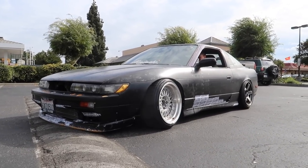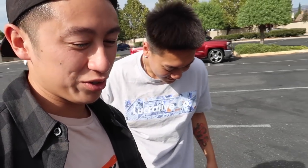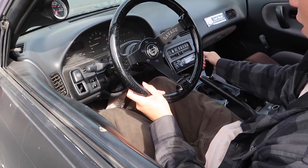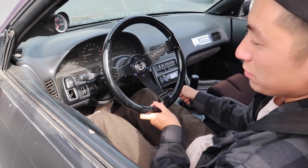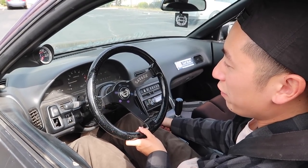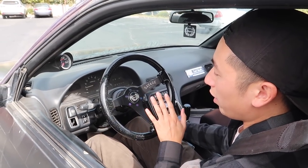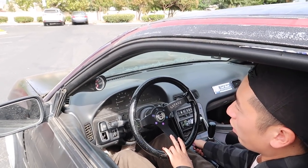It's fine bro, don't worry. Still trying to get Jason used to the clutch. So I'm gonna give Jason a little demonstration on how you basically get over the speed bump and control the clutch. So here's how it works: I'm in first right now. As I'm slowly moving my foot and the car starts to want to go forward, I hold the clutch there. Once it starts grabbing, you literally hold the clutch there and you give some gas, hit the angle, push through.